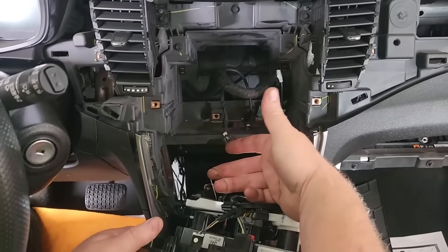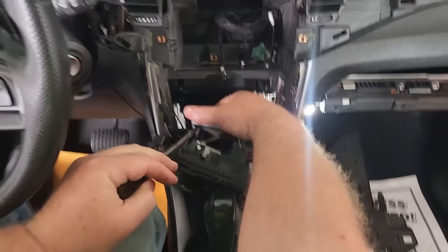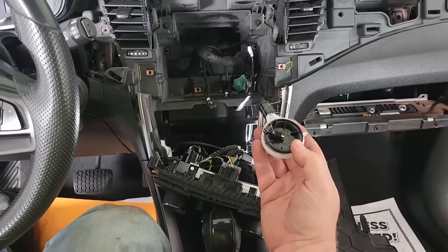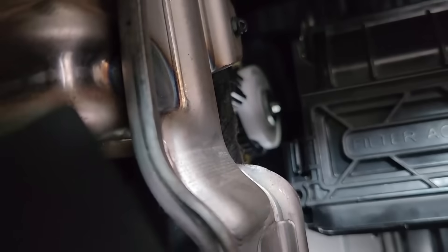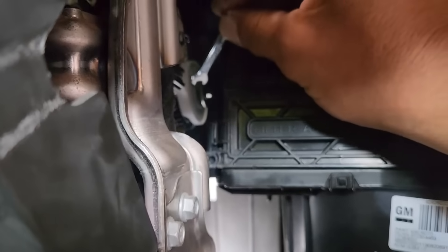The simplicity of this thing is it's basically plug and play — it just snaps in. So the first thing you want to do is take a screwdriver and pop this off. It has two snaps — there's the first one, and the second one's underneath. Pop that off, and then that cable runs underneath the dash. In the top left, that white wheel that you see — that's the other end of this cable. It takes a five-point-five millimeter wrench, and you can't get anything else in there to take this bolt out.